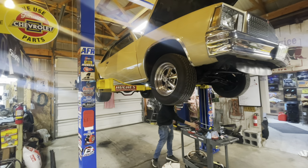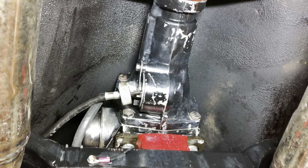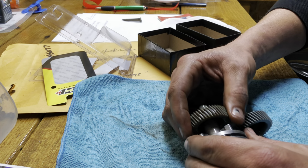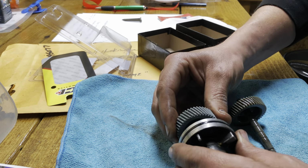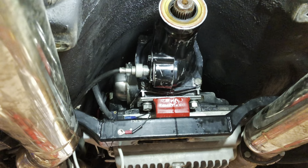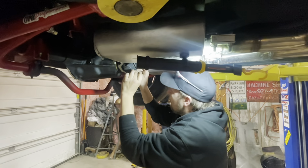So after Jeremy gets done getting Mark's blood pressure through the roof, he comes back to my shop to help me and Kenny work on the Malibu. Kenny's got the tail shaft pulled off of it so he can change the drive and driven gear for the speedometer cable. Since we switched to a 410 gear, the old gears are so far off the speedometer can't be corrected without changing the drive gear. So Kenny pulls that all apart and puts it back together.